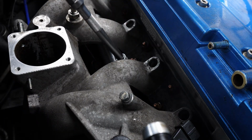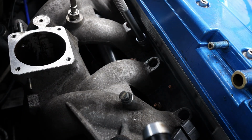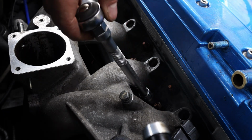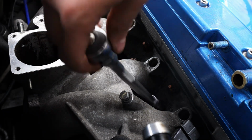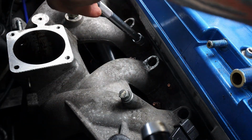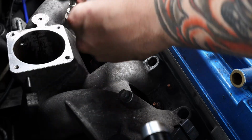The copper nuts are fitted back onto the studs, first nipped up hand tight, and then torqued to 22 Nm, starting with the middle 2 and then working your way out in a star pattern, like doing a rocker cover gasket or a head.